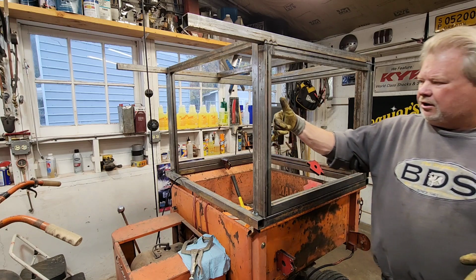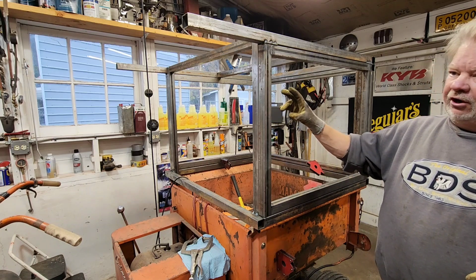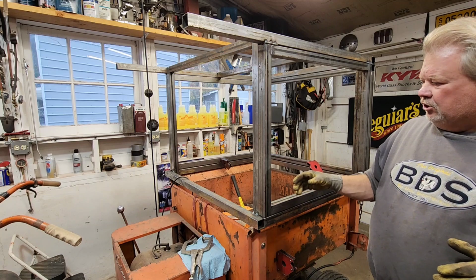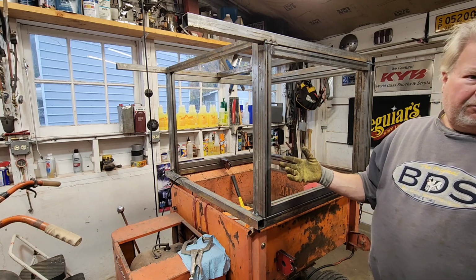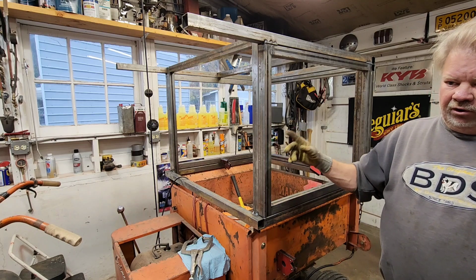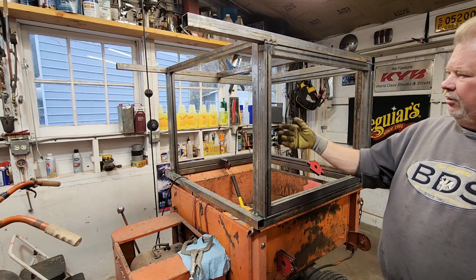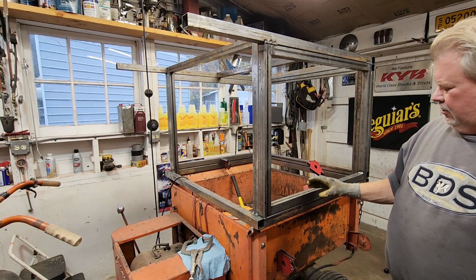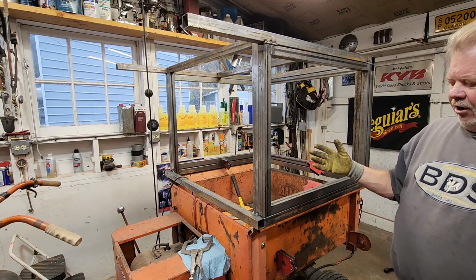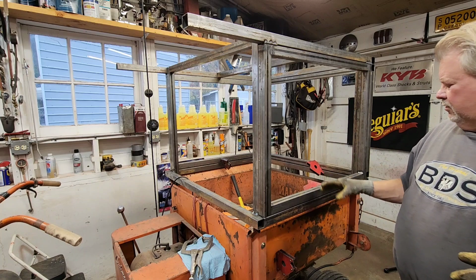I did some mock-up earlier, and I want like a 20-inch strut with like 8 inches of extension, and I think I ordered 40 pounders. I don't know, something on that order. I only ordered one pair. I think I only need one for this door, one for that door. I might put 2 on the back in case we hang something from it or whatever, but I'll get a couple and we'll see how they work. Mock them up, see how they work.